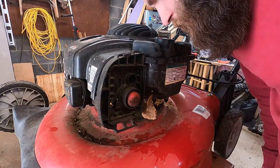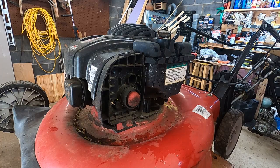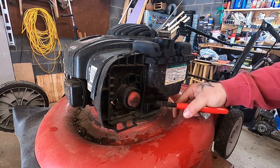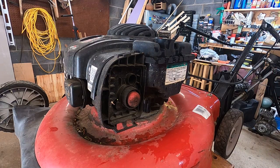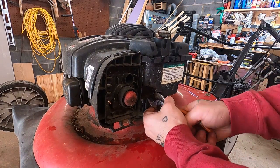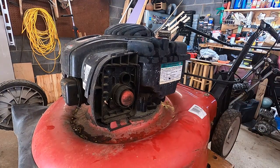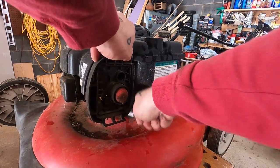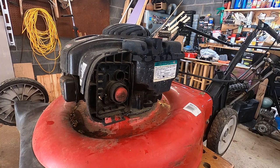Let's swap the green out for the red one and get back to work. This red one's interesting because that is just water in there - it is a tank full of water. So we have to assume the carburetor is going to be in pretty bad shape. But as we just saw she pulled, so maybe we'll get lucky. Maybe we just have to clean the water and junk out. There's gonna be some serious corrosion in that carburetor. Come along little dogey - I don't really want to break this plastic tank. I'll put new fuel line on - I just want to get the water out of that carb.